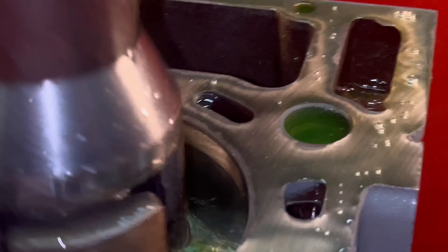This sucker is about to go on the stand. Still going — we're on the second side now, about done. All right, it's another day. The heads are way over there, assembled and done. The block is completely machined — we are now done with equipment. The block is ready, so let's uncover it and start final cleaning, brush the bores, brush the oil galleys.